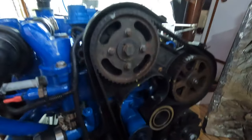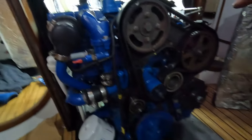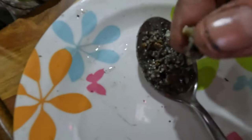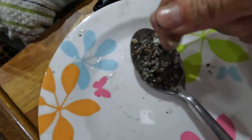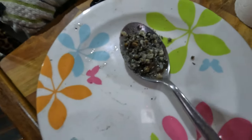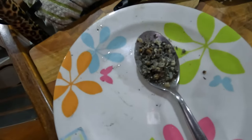All four pins out, timing belt on. I need to put the water pulley back on, alternator belt back on, and I've put coolant in here — we should be good to go. This is the stuff that's been inside our coolant system — it's like limescale. You can pick it up and crunch it and it sort of turns into just sediment. I think it's limescale deposits.